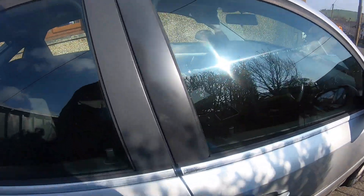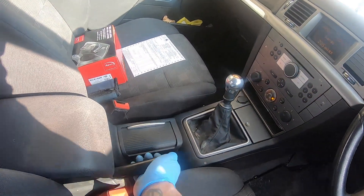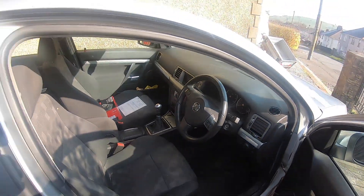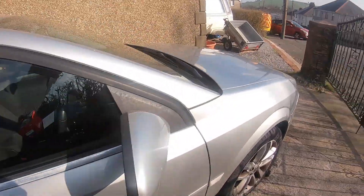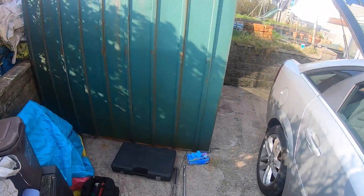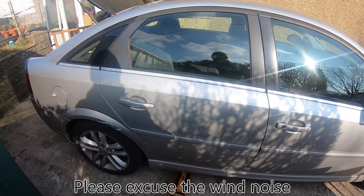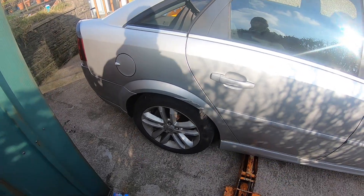So here we are. A couple of things I'm going to do before we start — that is inside the car. What we're going to do is, as you can see, I've put it in gear. I'm going to let the handbrake off, because obviously we're going to need to work on the handbrake, so you need that cable to be slack, otherwise it makes things a lot harder. But before I did that, I've got a brick this side underneath the wheel to chock it, and I've also got a pair of wheel chocks under the wheels, both on the other side, just to stop it going anywhere. We're also on a flat place, and I also made sure they wouldn't go anywhere in gear to start with. But this means we should have free-roaming movement of this wheel on the back now.